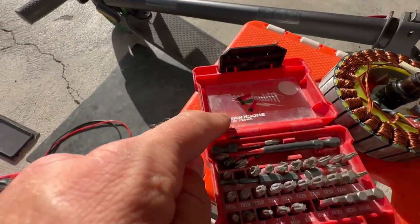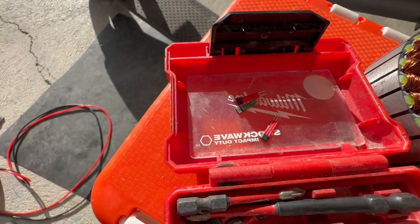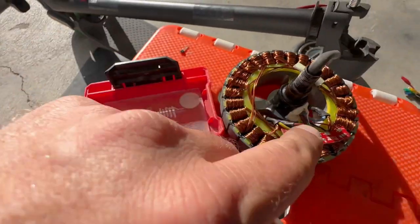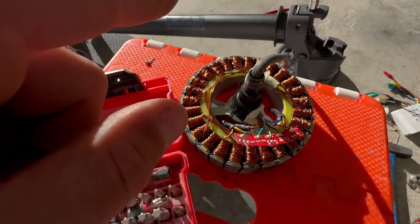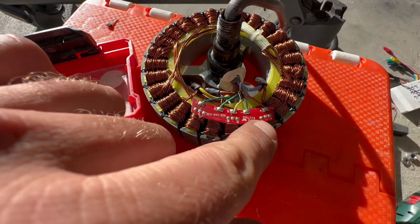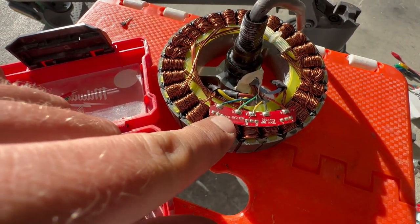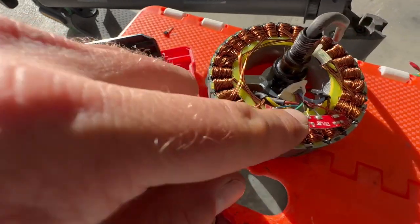The new sensors, we add the heat shrink, and it's very easy now to put them in with the clean grooves. But I want to mention something. As you see now, the board needs to be cleaned here, here and here, so you can put in the new sensor connectors and solder them.